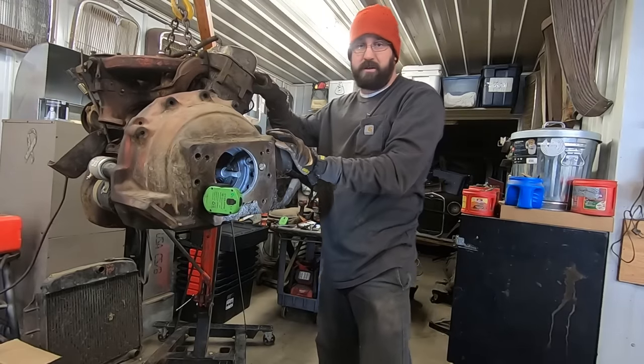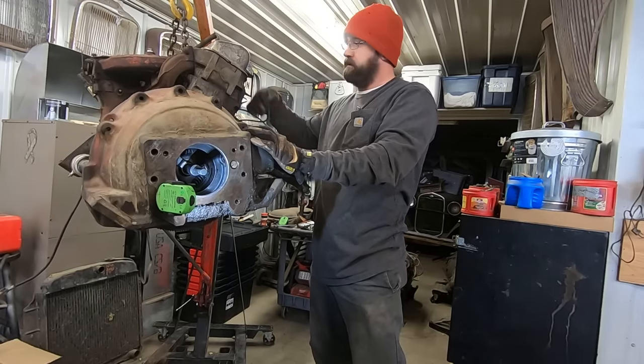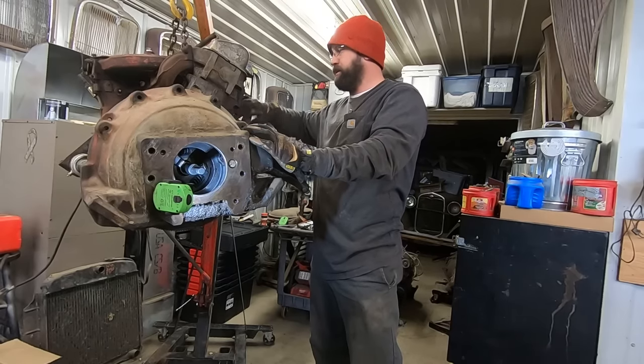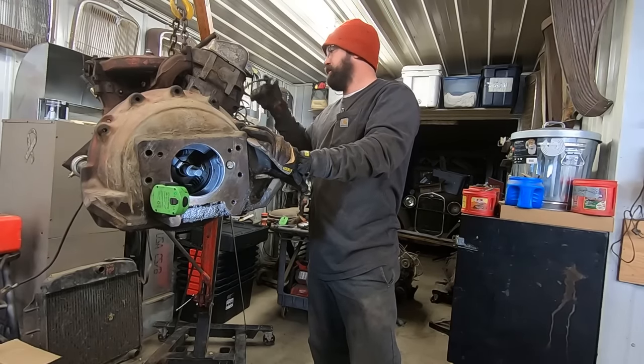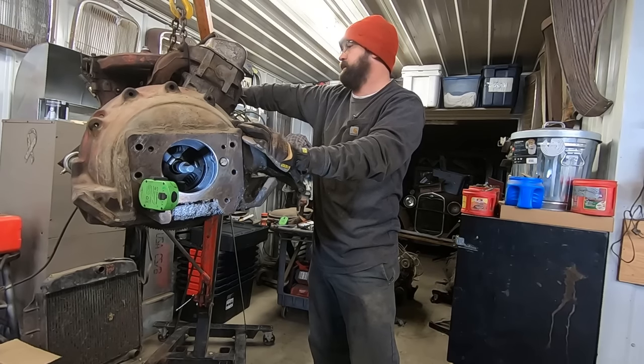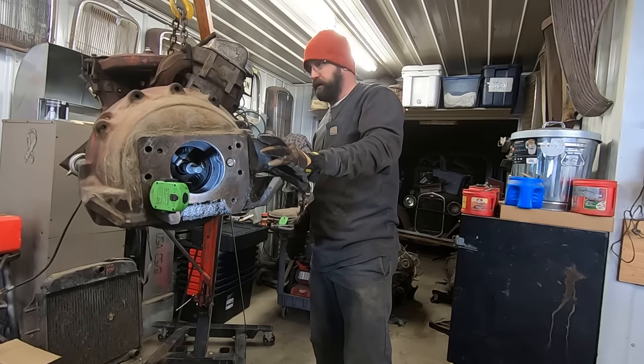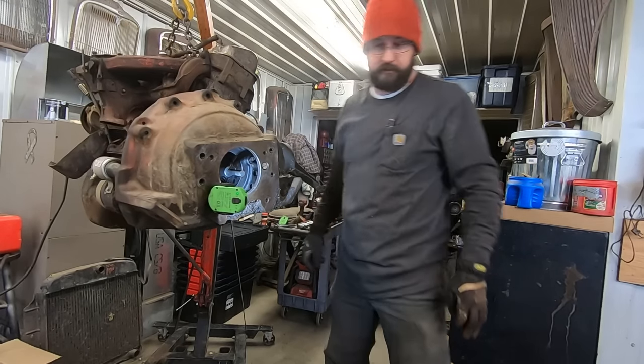We've got to pull these spark plugs out anyway. Forgot to change those to electronic. We're basically still on one of the other engines. So we'll pull those out, put a little Lubi-doob down the holes, see if it turns over then. I can't imagine they would have stored a stuck engine inside, but I've seen dumber things.